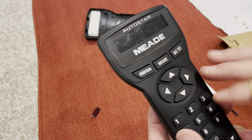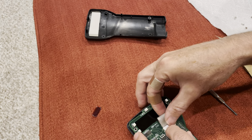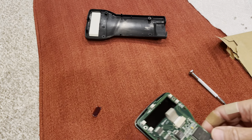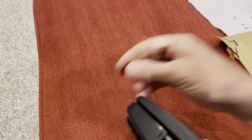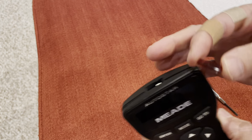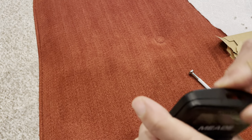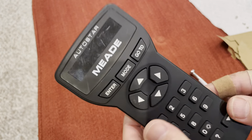Make sure your buttons are all sticking through the housing. Get your display cable put back in — on this one it goes underneath the little sliding connector plate. Once that's in, put your two halves back together. Before you totally push down on the top half, this little red piece has a narrower thin part on the end — tuck it in underneath there so it slides in at the top and the bottom, and it snaps into place. Once you get it all snapped into place, replace your four screws and you're all set.